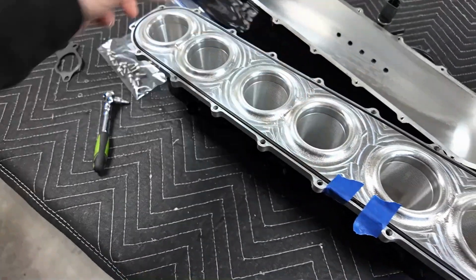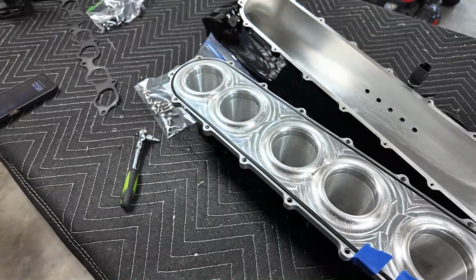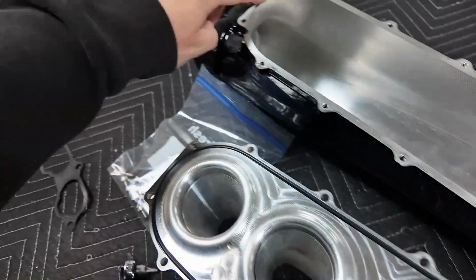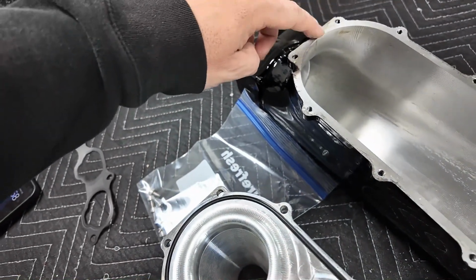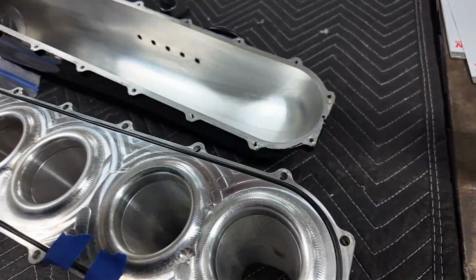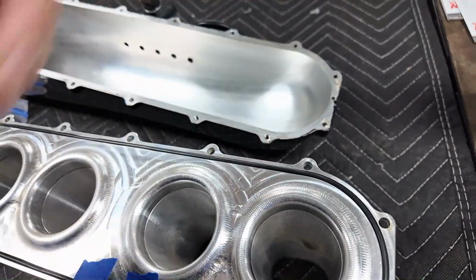So you have to make your own O-ring for this part, like a lot of the piece-together intake manifolds. This one here, you don't have to glue because that's just a long piece that sandwiches and it comes there. You leave it a little bit long so you can see it sticks up just the tip of it. I guess that's not politically correct anymore. Anyways, from my machining days, you call it the tip when you have the little bit coming up.